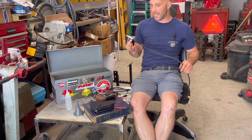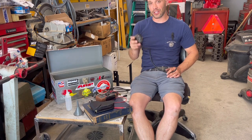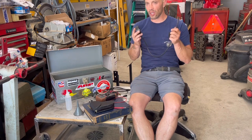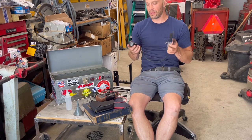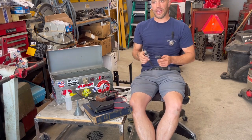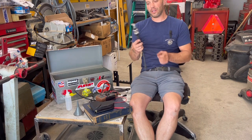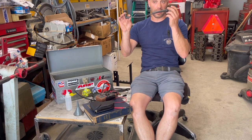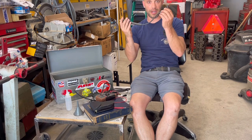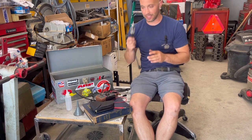Vacuum gauge. If you're going to tune a carburetor on this and leave it at your carburetor, you can do that with this to get a good initial tune on it. We don't use this a whole lot unless we have to, but it's always a good idea to have one. Another good tool to have — maybe something's missing, maybe you don't know what's going on. This here is a spark tester. It goes in line between your actual spark plug wire to the distributor and the spark plug. If it's firing, you got light. If it doesn't, you don't have any spark.